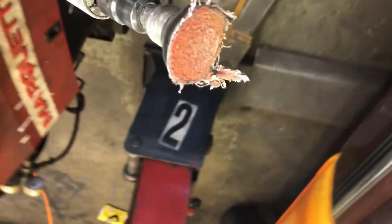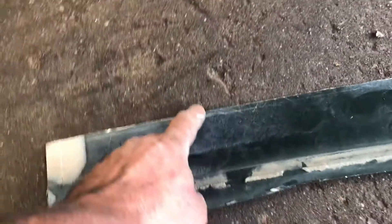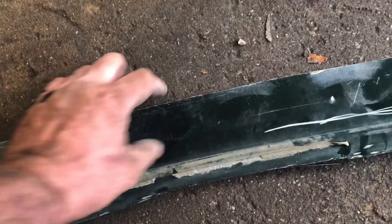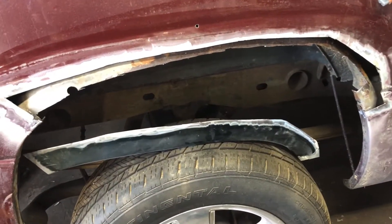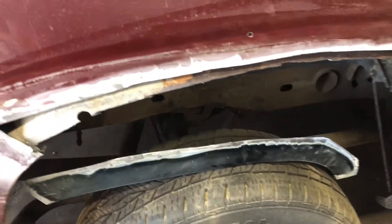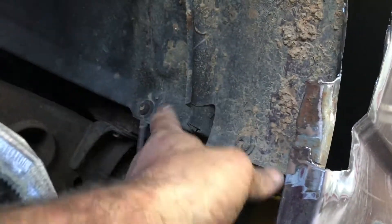I utilize the crap out of these things. Another thing you can do is cut two sections — one inch by two inch — clean that up, weld one here and one here to give it some strength behind the panel. Some people take a whole other piece and put it behind there. This is not a show truck; it's really going to be for structure. We do have flares to put over it, but it rotted away. You could always drill these all out or take a whiz wheel, cut straight around, grind it, and weld right to it. The inner piece goes from there to there — easily replaced later or you can do it now.